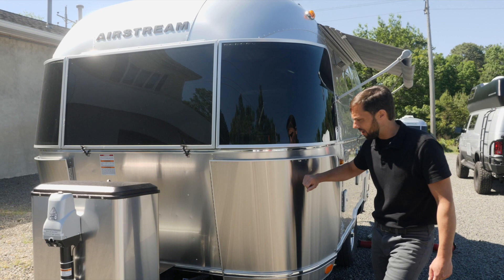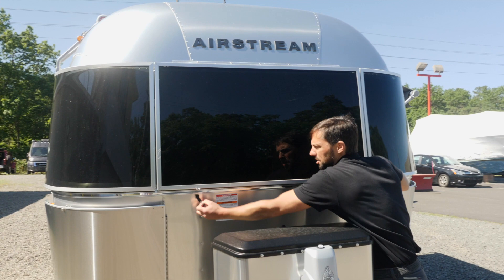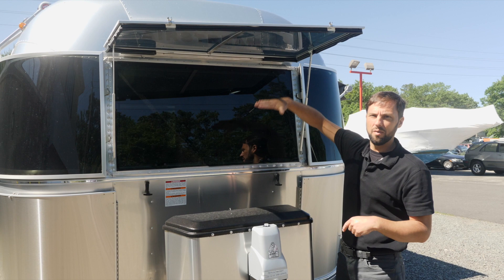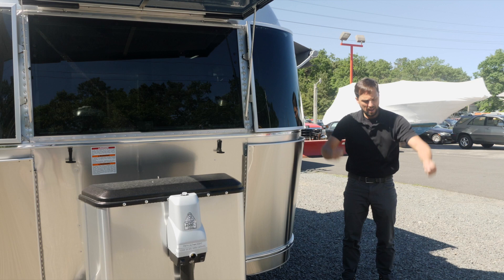The front panoramic window has solar stone guards — also rock guards. Pull the tethers, lift, and spin the knobs to lock in place; adjust the height to allow the window to open to three different desired heights. The corner pieces are removable — use a Phillips head screwdriver with a quarter turn to unsnap and hinge off, allowing you to lay it down and clean the glass. Remove them only for glass cleaning purposes.